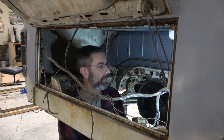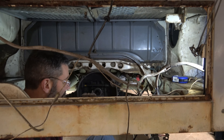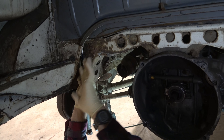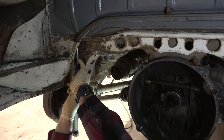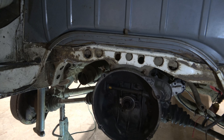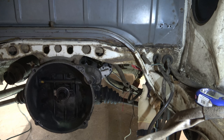Why don't we just show this happening here. I've got to break the seal for this, but it should be about ready to take out — I think I've got all of it loose. It's just stuck in by 30 years of goo. There are a couple of Phillips screws around the sides and one each on the underside that I need to get out. Once those are out, depending on how good or bad the seal is for the firewall, this thing should either pop out pretty easily or it may be a giant pain. After 50-something years, it'll probably come out fairly easily because that seal's probably gotten brittle and no longer functions properly.